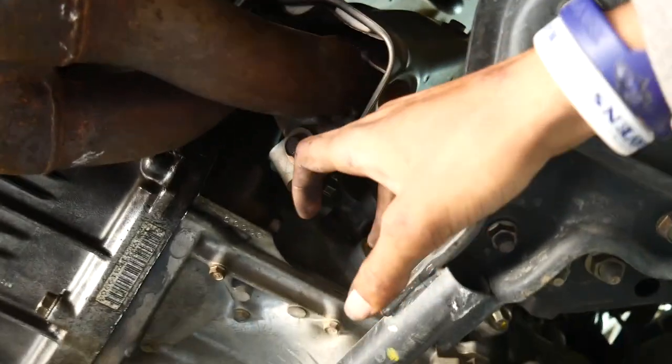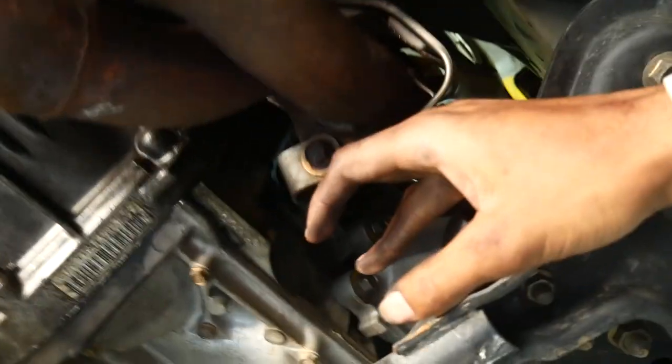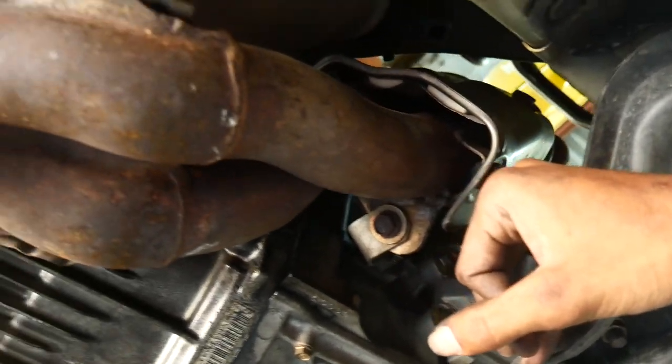We just lifted the car up. We are about to pull — we got to pull out the cat, which needs to go anyway because, you know, horsepower. Then we're going to go up in here, take out these bolts — this is the header bracket to hold it on — and then we'll actually be able to reach the transmission bolts after that. She's in the air, we're making decent enough progress.